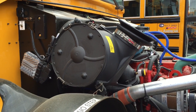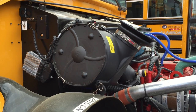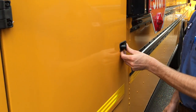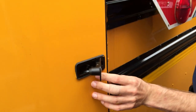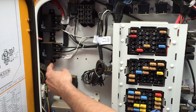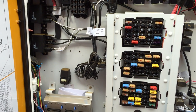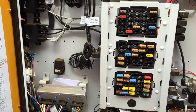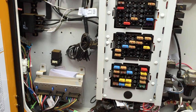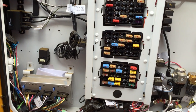That was on a conventional bus. On a transit-style bus, this switch would be located in the electrical panel. It's the same exact switch, located on the left-hand side. With your engine running, you'd go out, flip it up for a couple of seconds, and let go — and the engine speed will idle up. This applies to both front-engine and rear-engine transit buses; the switch would be in the electrical control panel.